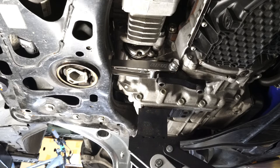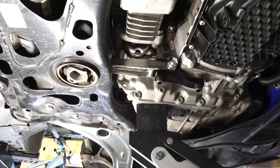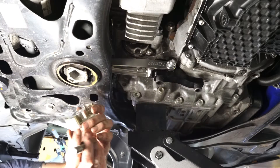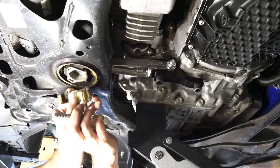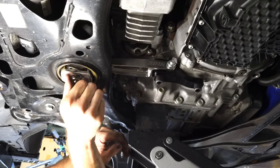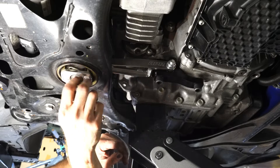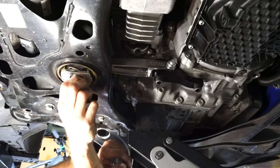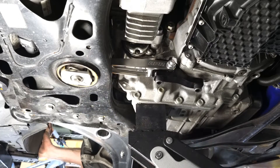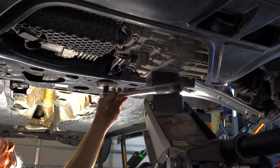You can also see here how I'm using a jack to relieve a little pressure and rotate that transmission just a little bit so I can get the subframe side bolt started without any resistance. You should be able to get it almost tightened all the way down by hand if you've relieved all the pressure. I didn't have to remove the upper insert at all — it just slipped right in — and then I removed the lower with the bolt.